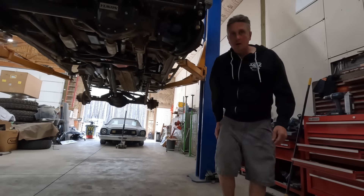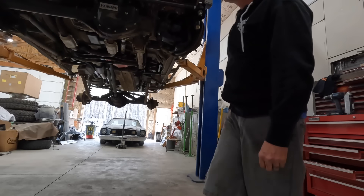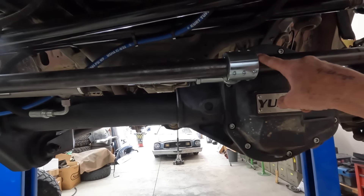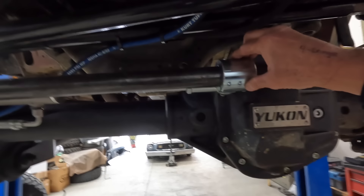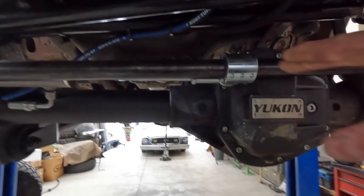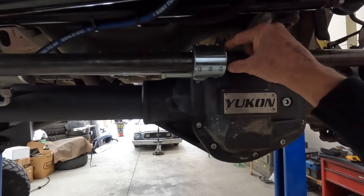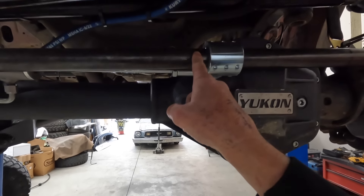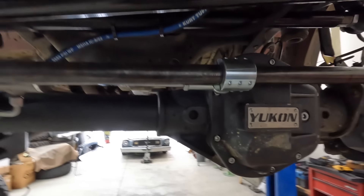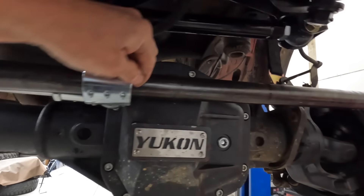Alright, back up in the air. I think what we're gonna do first is tackle the steering ram stop. What I'm talking about is basically this is a clamp-on type of unit, and I like the idea that if I readjust the toe, I can readjust this so the ram is at the right angle, but I don't want it to be able to push either way. So we're gonna make some sort of stops that weld onto the tie rod to keep this clamp from going either way.